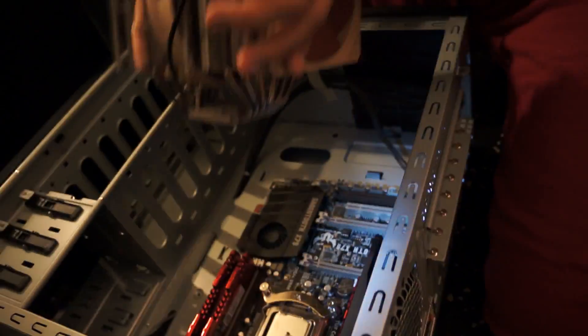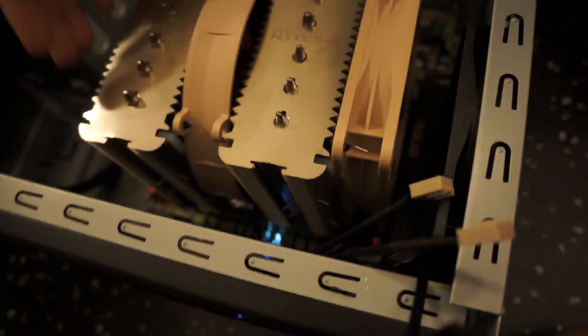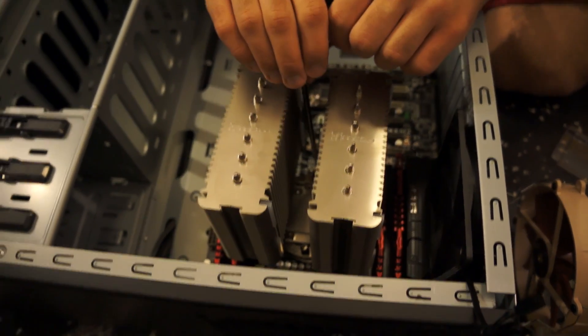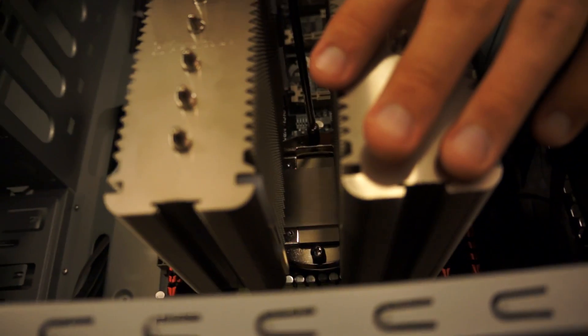Dude, is this going to fit with my RAM? I'm lining up... I'm just shooting light through that. Problem? Uh oh. Wait, no it's not touching. It's touching the RAM on this side. Alright, we're going to pause while we figure this out. If you get this heat sink, remember to take the fans off if they're already on, because in the directions it doesn't say take fans off — it just assumes the fans are off. So that's what our problem was. So we took them off. We did the dot thing and we put it down, and they were spread a little bit because we had the heat sink on top of it a second ago.